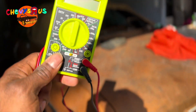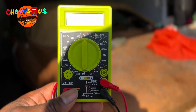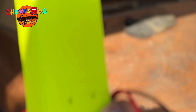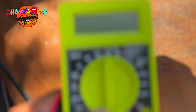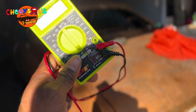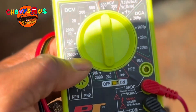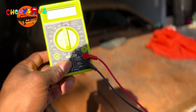This is actually called a multimeter, and this is the device that we are going to be using to test the spark plug wire to determine if it's good or not. You can get these at Harbor Freight for about 15 to 20 bucks. They sell the deluxe digital version that's all fancy, but this is all you really need right here — a multimeter that has DC and resistance, ohms on it. If you never used one before, they come with two wires: a red wire and a black wire.